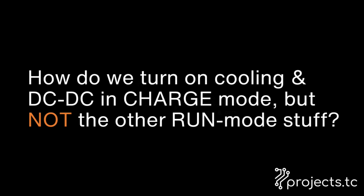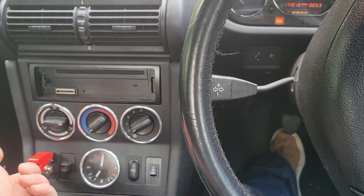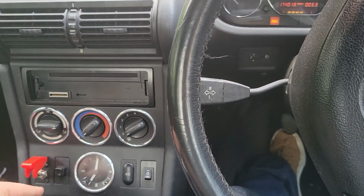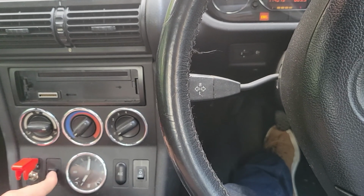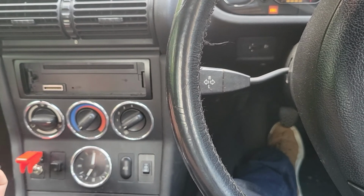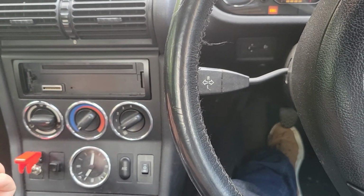There is a second charge mode related problem with my wiring. When I put it all in, I had a switch and a button to turn on charge mode, then close the contactors. The problem was I had the DC to DC converter enable line connected to that charge mode switch, so that I was enabling the DC to DC converter before I closed the contactors.